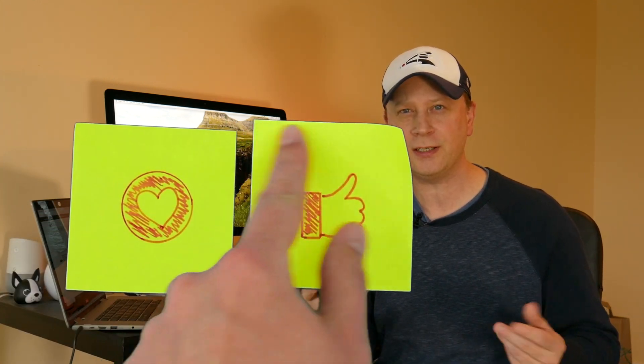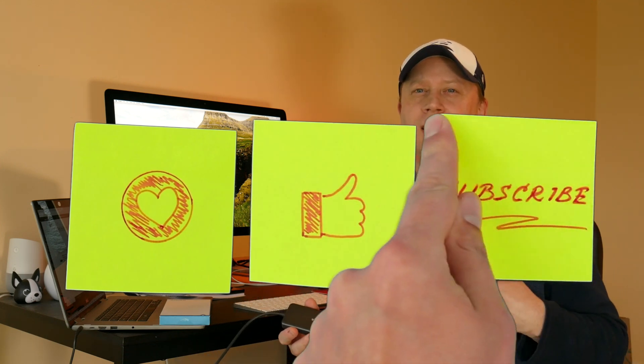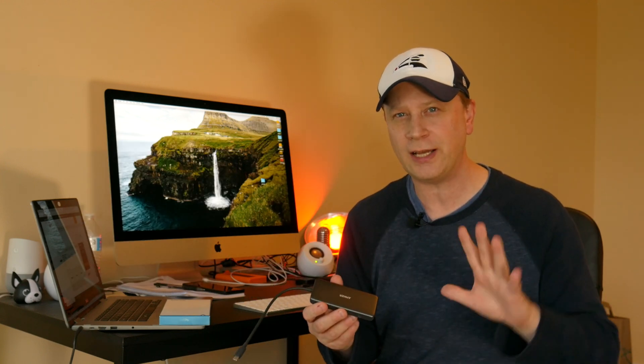Thanks for watching. I highly recommend this — it feels very robust in the hand, you can throw it in your bag and it's going to last a long time. Yes, you do lose a little bit of speed, and on some other hubs like the Vava it didn't seem like you lost as much, but this is still pretty close with good throughput on SSD drives through the USB port. It does have a USB-C port and it's one of the cheapest options you can get with data support. At $25 you may not get everything at full speed, but you're going to get about 80 to 85% of it.